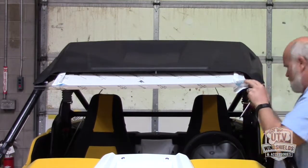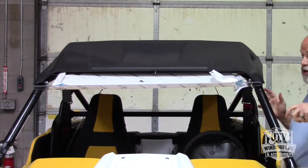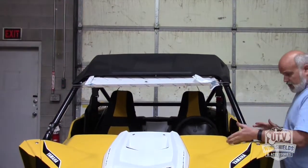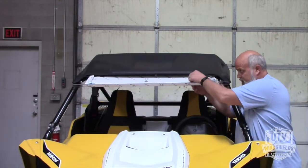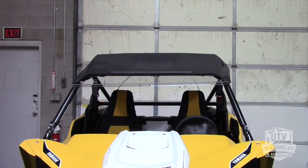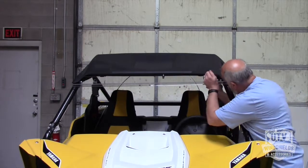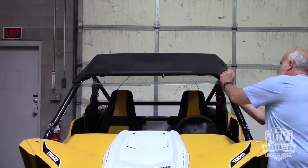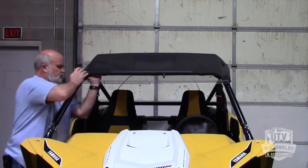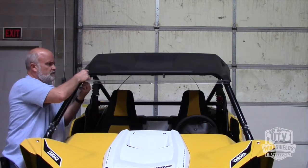And we're set. Now you're going to push this back, and I know this windshield is going to fit. So what I would recommend, if you have any questions about keeping your windshield, is to install your bottom piece now before you get this top piece hooked up, because there's really no way to hook this top piece up without taking off your protective plastic and therefore voiding the return. So we're going to shove this right up tight to the roof. This bottom lip, you have to kind of force up into here, and that's where we're going to keep it.